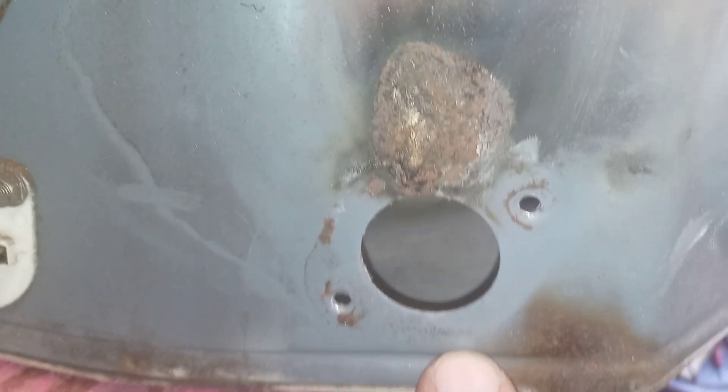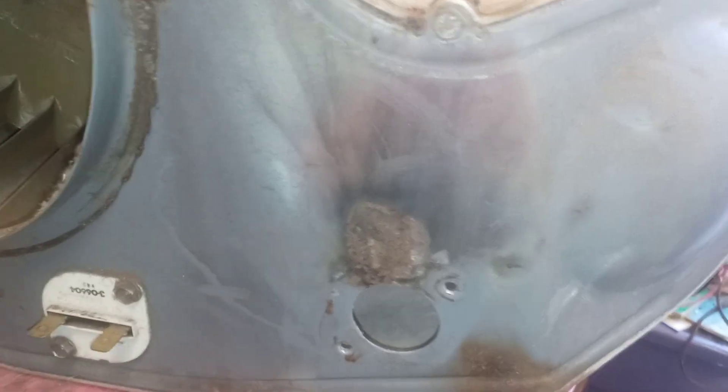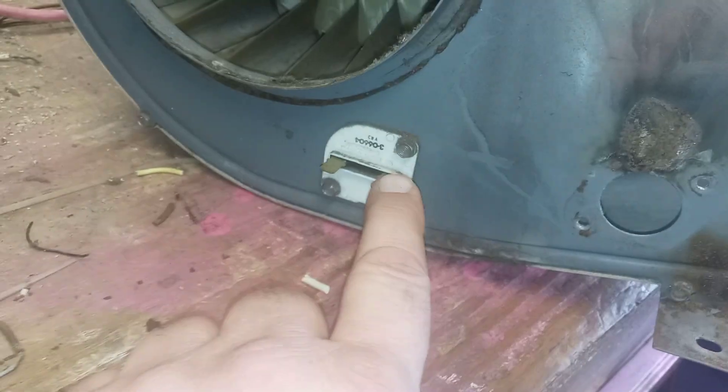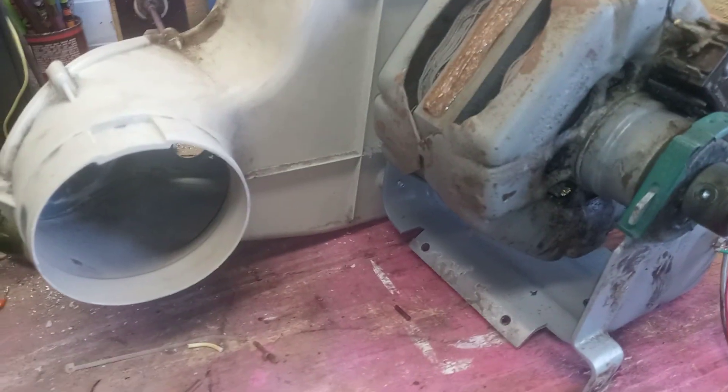I took out all the other electrical things. It looks like they'd had a fire in this thing at one point - that would have been where one of the heat sensors was, either an overload or one of the dryness sensors. When the clothes are dry the air gets hotter and it kicks off. Somebody had the wires bypassed. Guys, on an electric clothes dryer, never ever bypass any of these safety features. This is a thermal fuse - anything electrical with heat sensors and overload switches, don't bypass them. If they're bad, replace them, because that's a fire hazard.